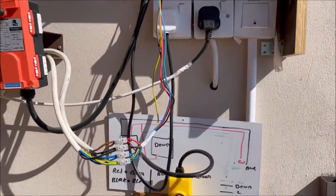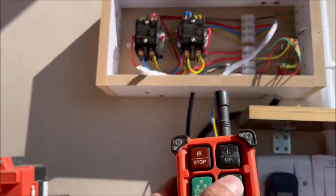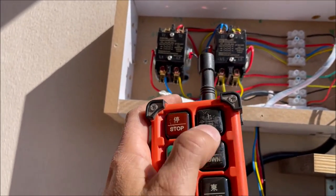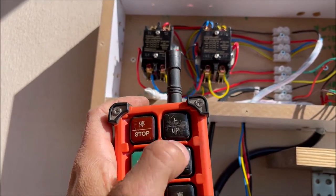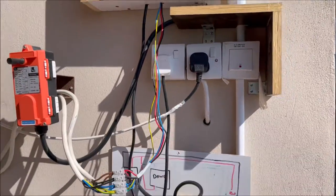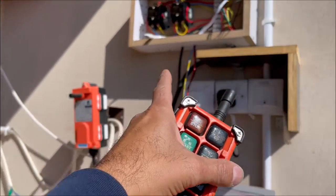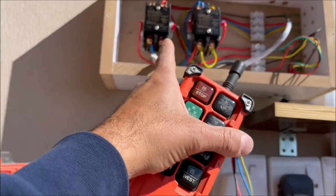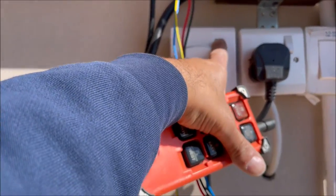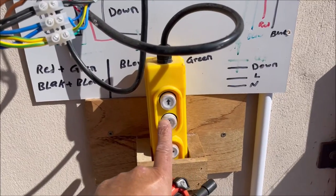When you finish, just press stop. The remote is controlling only the relays. So if I stop the winch, I can disconnect the winch from the remote system and operate up and down independently. It's two separate units now — the winch is separate and the remote control unit is separate. In case of any failure, just disconnect the remote and operate the winch normally.